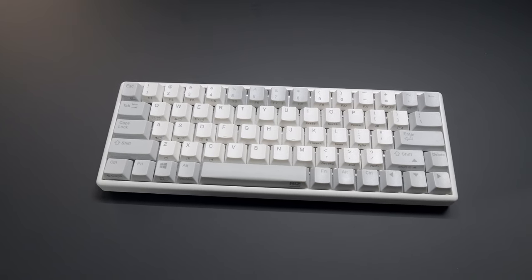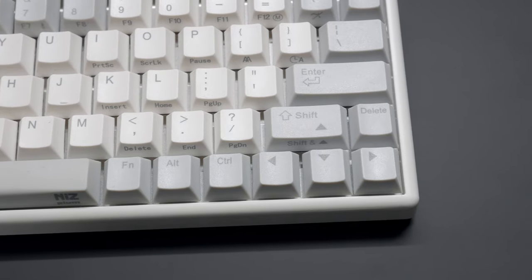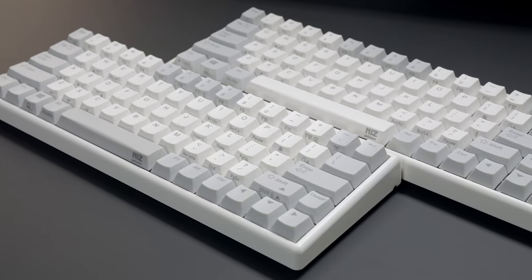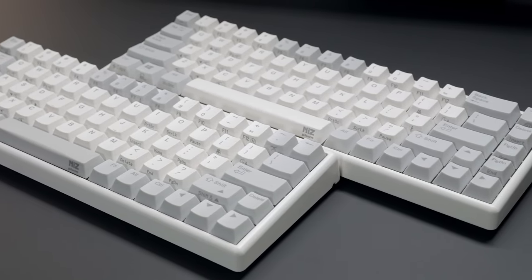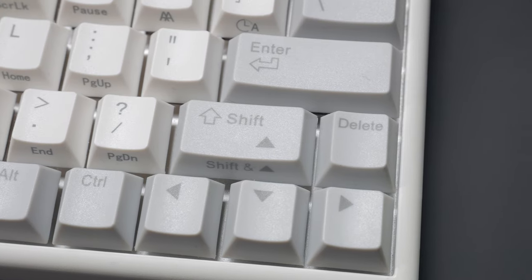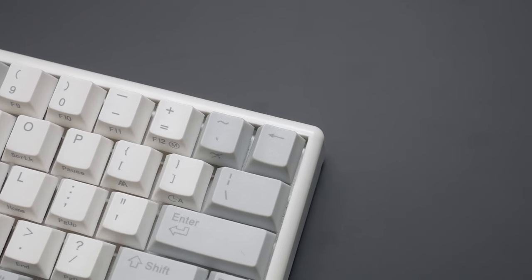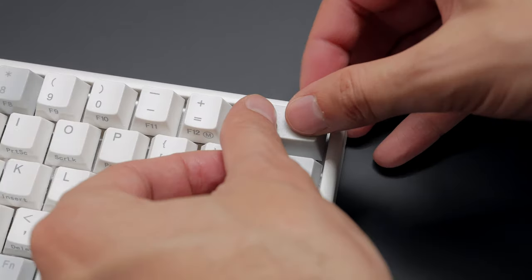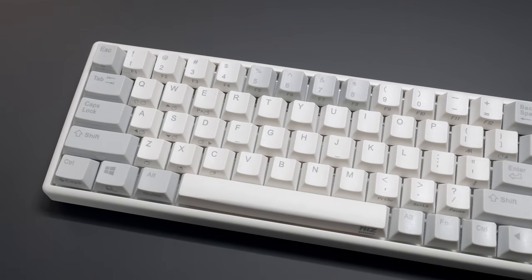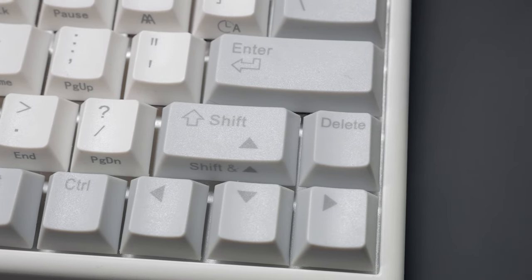On the other end, the 66 is one column narrower without effectively losing many keys, so it comes with multiple compromises. You have the same non-standard keys as the 68, but also a smaller spacebar. The left side modifiers are also smaller, and you get 4 keys there instead of the standard 3. Then the arrow up key is merged with the right shift key, and finally the backspace is 1 unit wide to leave room for the tilde key. Although you can replace these 2 keys for 1 standard backspace key. I much prefer the layout on the Atom 68 as it's more standard, and I'm not a fan of the right shift doubling as arrow up, but more on that later.